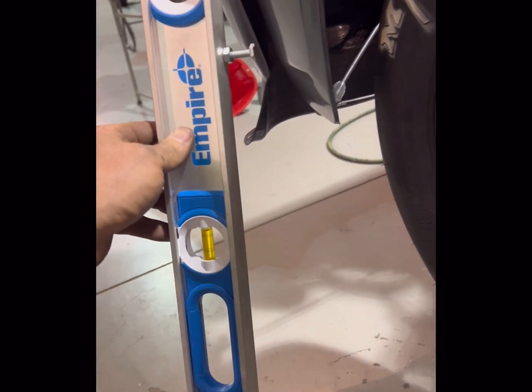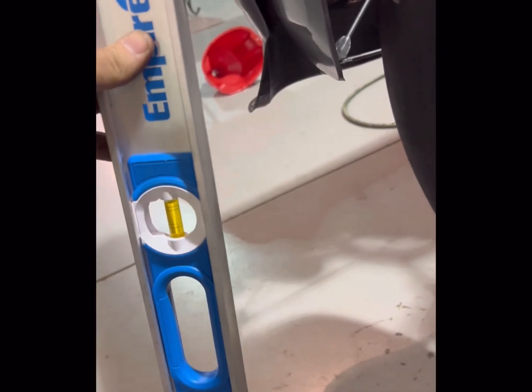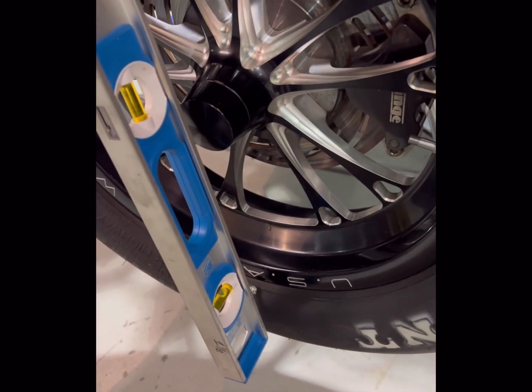That's gonna cause some issues. So if you get yourself a couple jam nuts and a couple bolts right there, they're probably like 1 inch, 2 inch, I don't know. There's some bolts. I just drilled a hole and tapped them through, and then use the jam nuts to set it the same distance off. And that'll get you over where your level doesn't hit the tire.